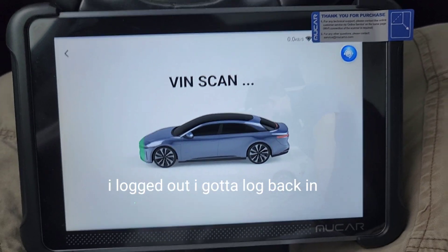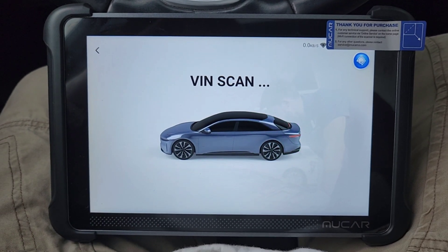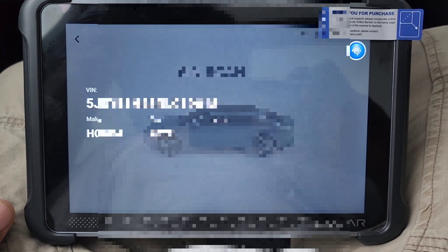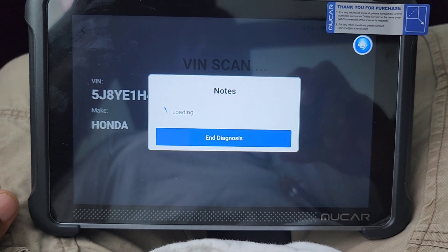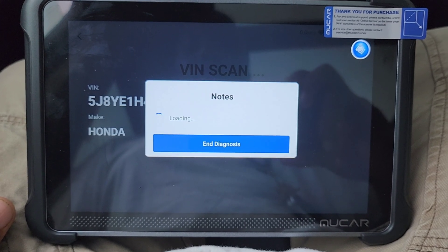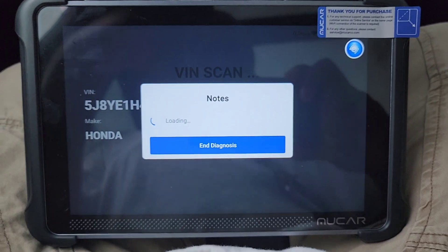You have to go to one push start, put two-way keyless access, then program in the remote and the remote start will work for whatever vehicle you have — one of the new years though, TLX, MDX, RDX — as long as you install the module that needs to be installed, you can program it with this tool.